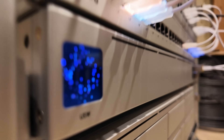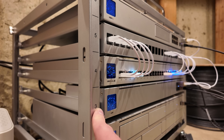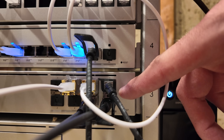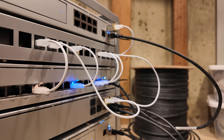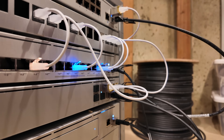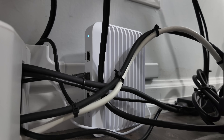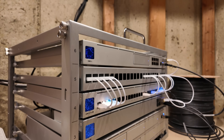In slot number three I have a UniFi aggregation switch — that's a 10-gigabit SFP+ aggregation switch with eight SFP+ 10-gigabit-per-second ports. It runs from my UDM Pro down to the aggregation switch, and then out to the USW Pro Max, my UNAS Pro, the 10-gigabit switch in my office, and a number of other places. That aggregation switch has really sped up my network — I'm very excited about it.